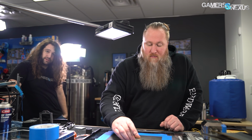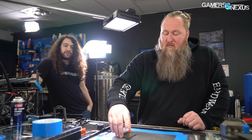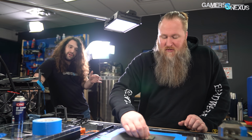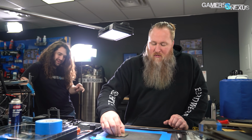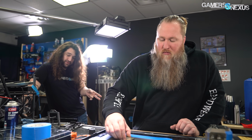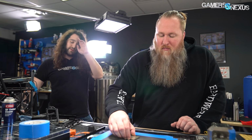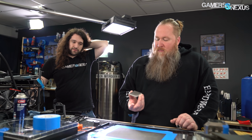And you're not just going to do this to the CPU. You need to do it to your cooler, too. So this could be really flat, and whatever you're cooling with, not so flat. I'll note, too, for more mainstream standard consumer use, Asetek coolers, for example, will have a slight concave, I think. I always mix up those. I've written about it before. They have a slight concave in the surface to match specifically with the Intel CPUs, because that's when they were designed, when Intel was the only real thing. So you have to be careful with that, too, when you're deciding if you want to lap stuff or not.